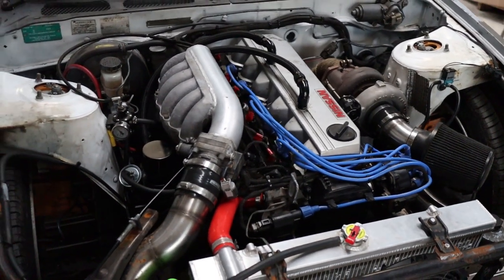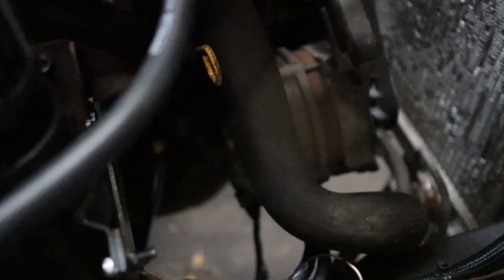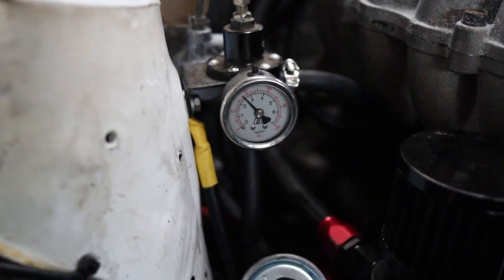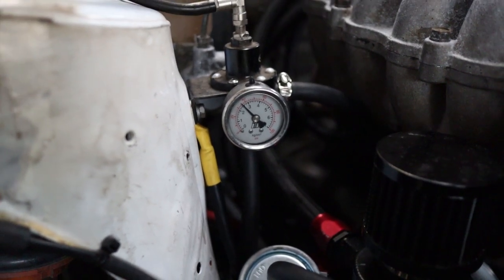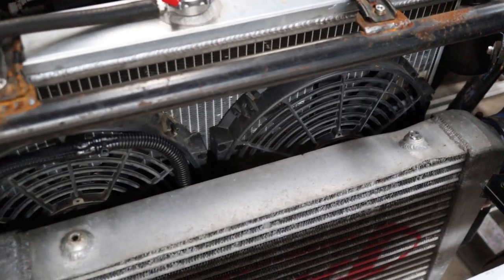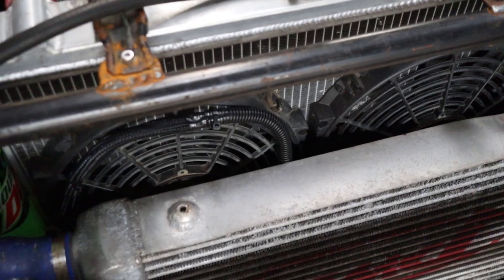Very, very cool car. We actually had the exact same issues with this car. RB alternator charging all over the place. This one was actually charging at 15.5 volts, which was causing us a lot of other issues. It was causing issues with the fuel pump relays. It eventually did kill the fuel pump, which was a pain, but this thing also needed a new alternator.